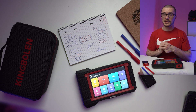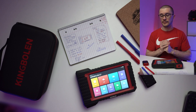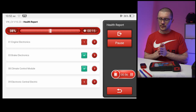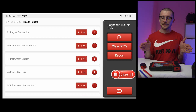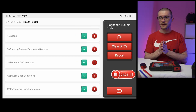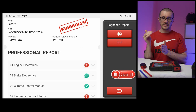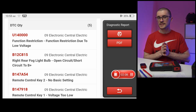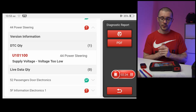I'll look further at G30 coding if I get the chance. On the Volkswagen Golf 7, everything went according to plan — it scanned the vehicle. What I would say, if I want to be picky, is that it doesn't give you in the report the status of a DTC — whether it is present, intermittent, or a history DTC. But it's quite a good starting point for your own diagnosis.